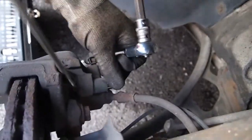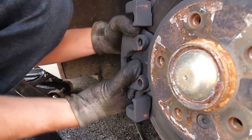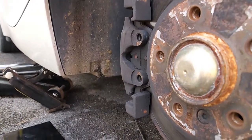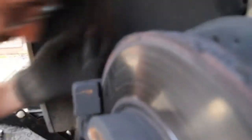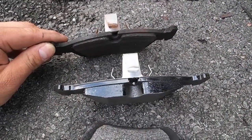You've then got to try and slide them out. That needs to be fixed. Once you're moving the wheels and you see absolutely no pad next to your disc, you're definitely in need of a change. If not, yeah, you're crazy. Once the two sliding pins are out, the calipers come straight off — but sometimes it's never that easy. The brakes had worn basically a lip onto the disc, which meant you couldn't get the pad over the lip. Honestly, sometimes a bit of brute force works just fine. Yeah, that's pretty worn.